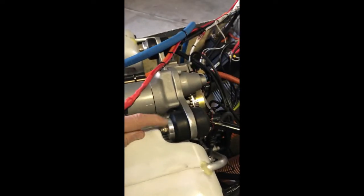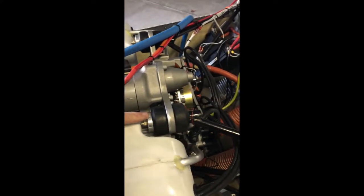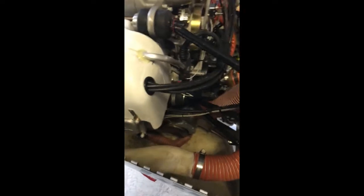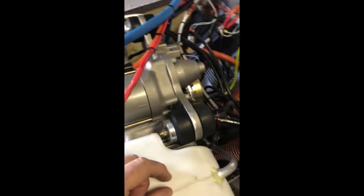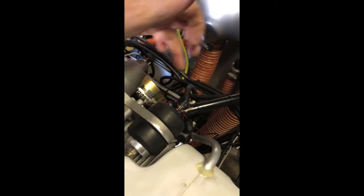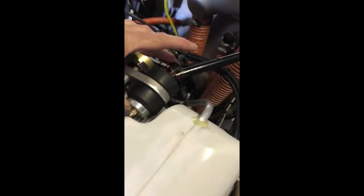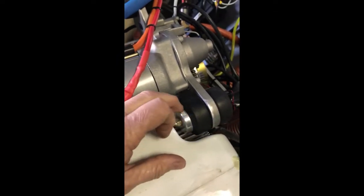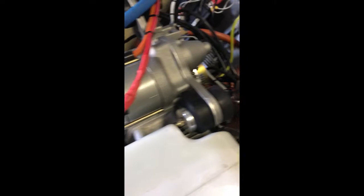As far as the engine goes, we had to manufacture a special tool to compress the engine mount rubbers. The Jabiru manual just says to use a G-clamp, which is fine up on top. Access is a bit hard without dropping the bottom cowl, but we can work with it. For the bottom engine mounts, we manufactured our own G-clamp. There's a 7/16th bolt — the head of the bolt goes in the subframe. You need to compress those rubbers enough to get the nut started, then torque goes up. The aluminium washers, which are like a top hat section, bottom out on the airframe and engine frame.